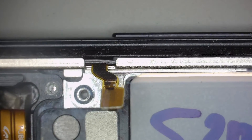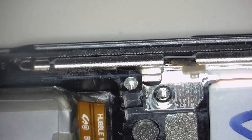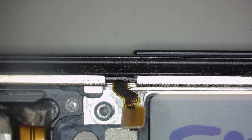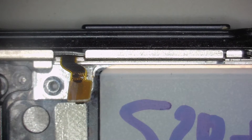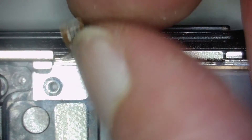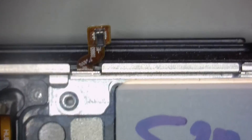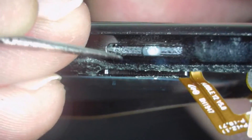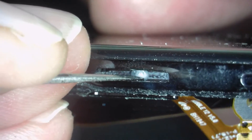You can reuse them — the razor blade marking will be very minimal. Behind, you can see the hardware button which connects to the flex. If that button inside doesn't click when you push the plastic out, you have to replace the whole flex. Just use a thin tool, a needle, or tweezers and push — if it clicks it's going to be fine. Now we have the S20 Ultra.